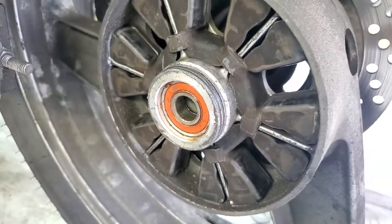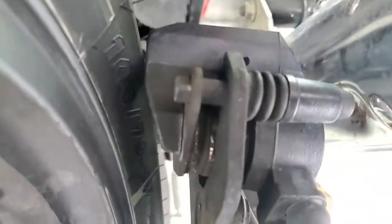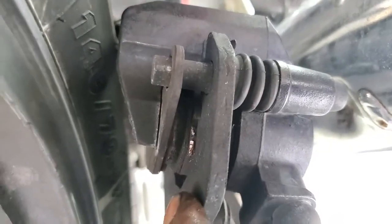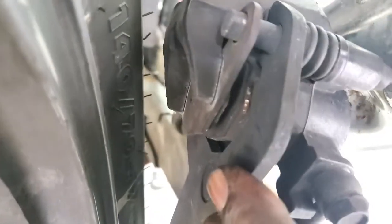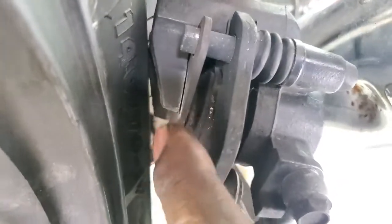So in my opinion, I don't think you need wheel bearings at all. We're gonna change out your rear brake pads because they're pretty skinny. They should be clean and these ones are filthy — there's probably like a good 11% left there. So let's change these.